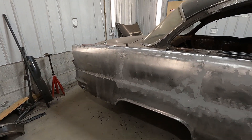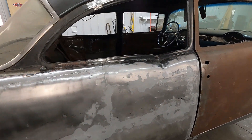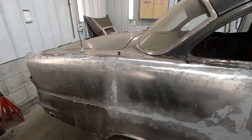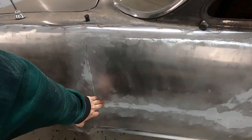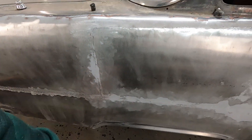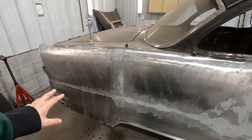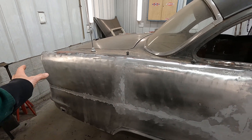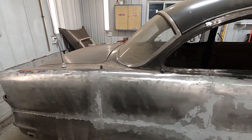You can see where I stitched on the lower quarter panel and I've just started playing with some of the metal-to-metal filler. I'll be using direct-to-metal products — I've had people say I should epoxy the car first, but I'm not doing that. I'm using metal-to-metal filler from Evercoat, and then after that I'll use direct-to-metal Evercoat Rage filler, then prime and block. I still have lots of metal work to do.